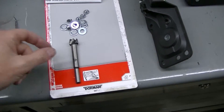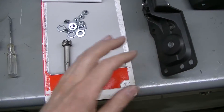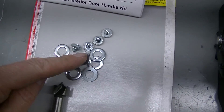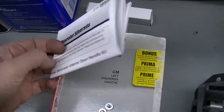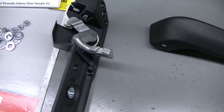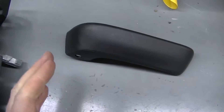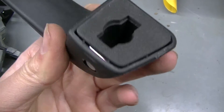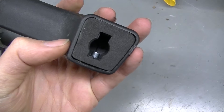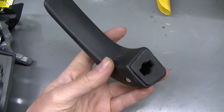This is what comes with the Dorman kit: a drill bit to drill out the plastic rivets that hold the handle in place, new washers and little screws to replace the plastic rivets, an instruction manual to help you out, and the handle mechanism itself. It looks just like the factory piece. You also get a new door handle — already assembled with the pin, clip, and foam piece. Some people have a little trouble getting it in because the spring may be stiff, or you could reuse your old handle if it isn't broken.